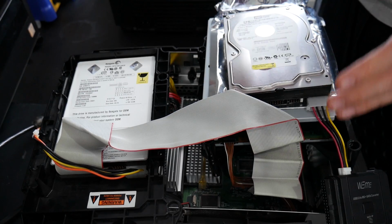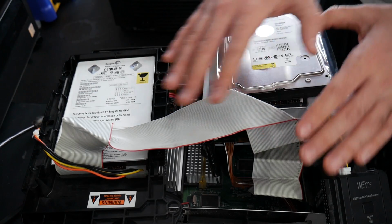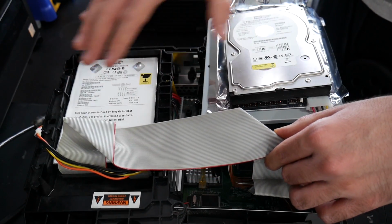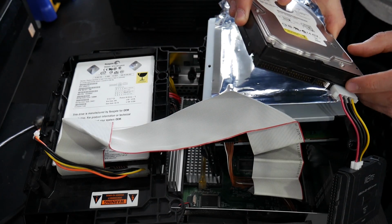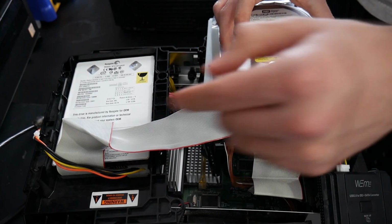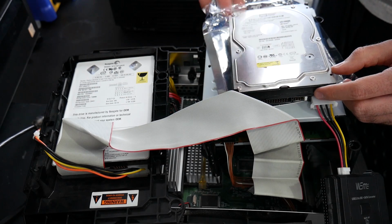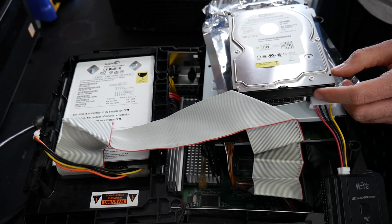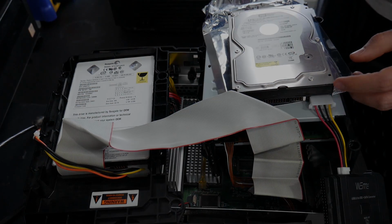But once you're all comfortable and situated, go back over, hook up your Xbox with everything hooked up as it should be. Again, you're going to need your hard drive and disk drive looking something like this. You're going to need to have your hard drive hooked up to either the Y adapter if you used one, or you're going to need it powered before you turn on your Xbox, and then you can continue on. So let's go ahead, hook this up to our TV and continue with the rest of this tutorial.